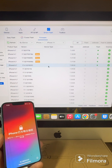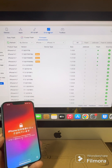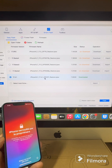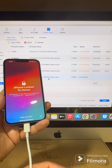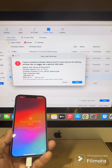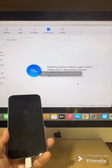On the iDevice it's 21E237 — you just click this green button and it downloads. I already downloaded it, so we hit Easy Flash, go to the software I downloaded. I confirm the 21E237, make sure the phone is connected. Use a good fast-charging wire. Start the flashing process, hit the flash button. It says a good USB connection improves success rate, so use a genuine cable. And here the process begins.